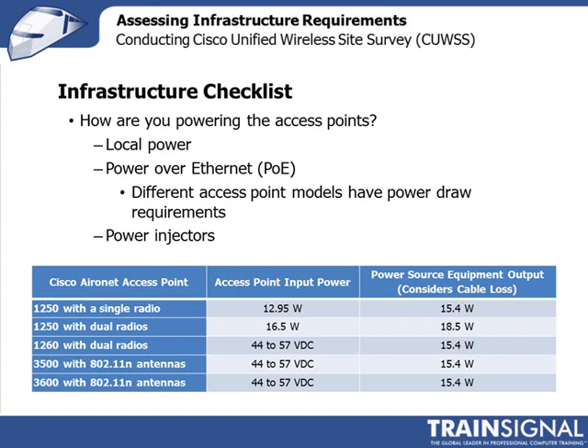If you're trying to do a 3x3 or a 4x4 MIMO deployment, you may find some of those antennas are disabled and you're only able to get perhaps a 2x2 MIMO. The other thing that can happen is that the radios can turn off or the access point may keep rebooting itself. So it's really important to make sure that the access point is adequately powered.